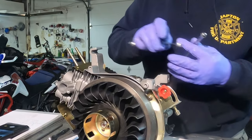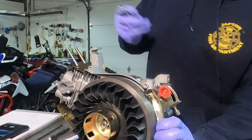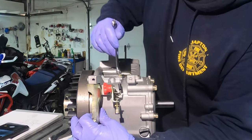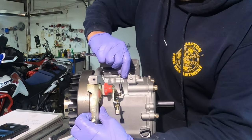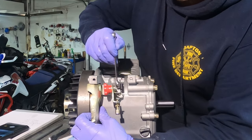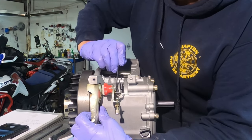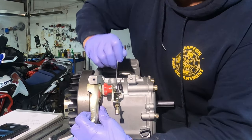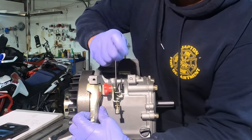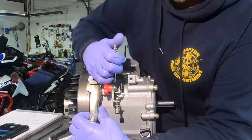We've got the bottom on where it's supposed to go — eight millimeter on the inside, ten millimeter. It looks like this can be adjusted slightly. What I'm looking at is wanting a little free play, and I'm just assuming this because I really don't know until we start running it. I just want to make sure that spring had at least a little bit of looseness in it, because it is your throttle stop. If it's pulling on that governor arm, it's going to keep pushing fuel — it allows that arm to go all the way to a no-fuel situation, and that's what kills it.